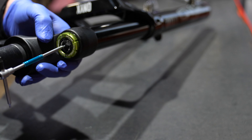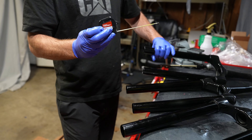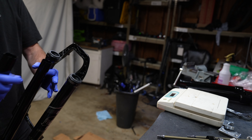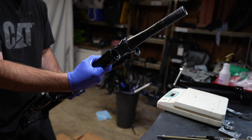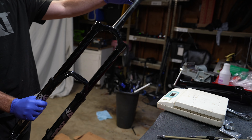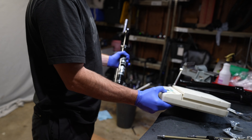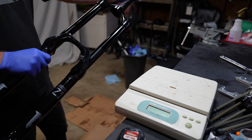This is the most conventional looking air spring on the market — almost every standard brand has one. It's a self-equalizing positive and negative chamber system: everything above the piston is positive and everything below is negative. It fills the negative part through a dimple in the stanchion, and the location of that dimple tells the fork how to ride. DVO told me they spent a very long time developing the location of the dimple — it determines whether the fork is linear or progressive. A ZEB is super progressive so maybe the dimple is higher up, and a super linear fork like the Marzocchi Z1 may be down low.